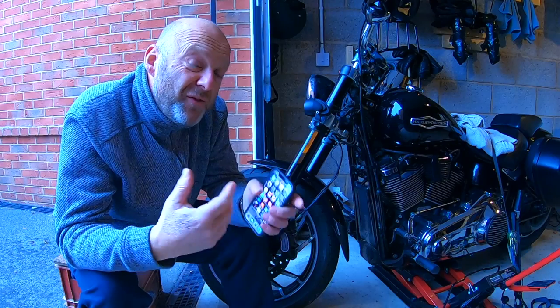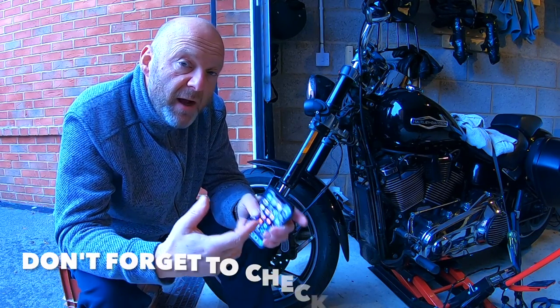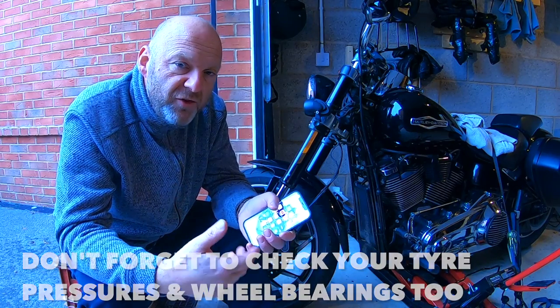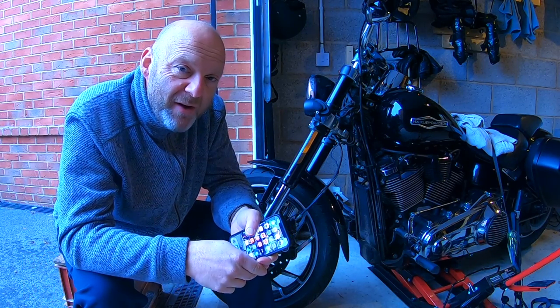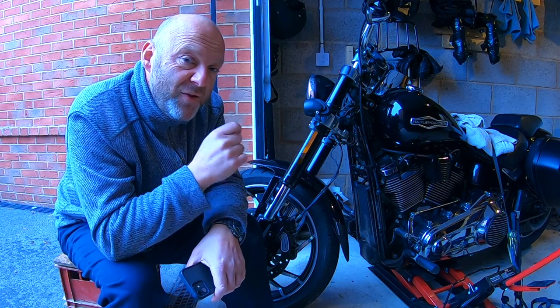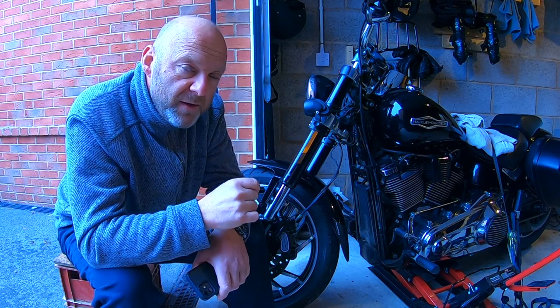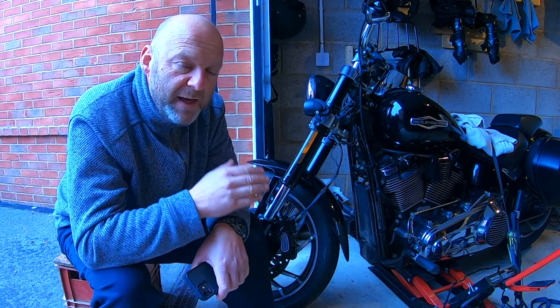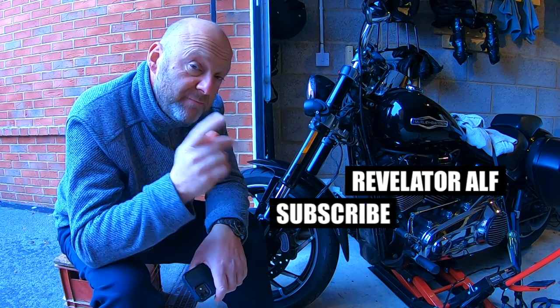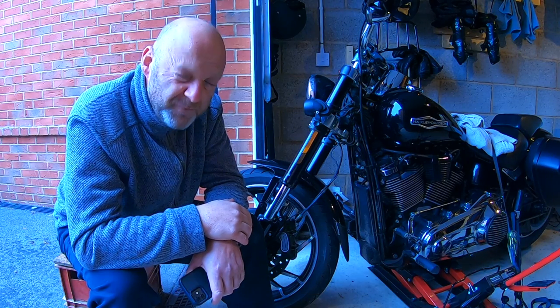If you're riding down the road and your steering feels a little bit vague, you need to check wheel alignment and your steering head bearings. This video covers the steering head bearings; in the next video I'll talk about front wheel alignment. Don't forget to subscribe, hit that bell, like and share, and check out the website revel8alph.com.